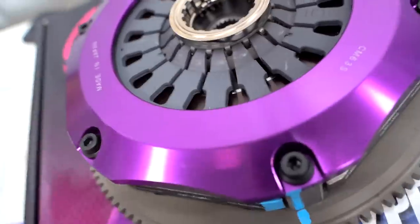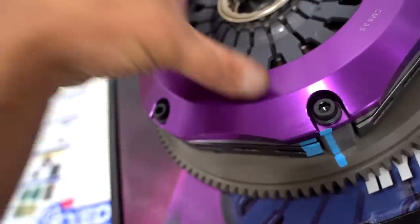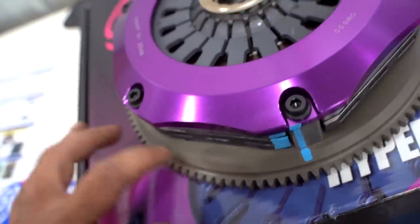Exedy makes and produces the nicest clutches we'll ever need — literally every car in the shop could use an Exedy twin or triple. I've got my new shirt on and we're ready to work. First thing we're going to do is pull out all of these bolts — these hold the clutch cover onto the flywheel and hold all the discs in between. We've got to pop out the six bolts and get this flywheel mounted up onto the car.